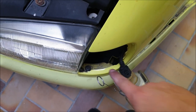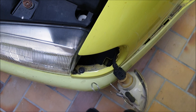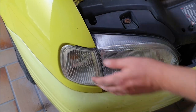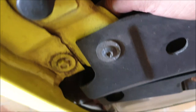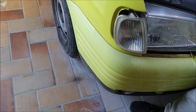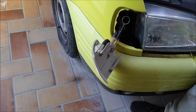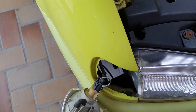You can see there are some hidden screws under the outer lights. I will show you how to remove the outer lights. There are hidden screws under the direction lights and there is a little trick. Here is a spring — you need to pull that spring to release that outer light. Pull the spring, put it down when you have pulled it and then you can release the light. And you can see there is the hidden screw — it is a Torx T30.